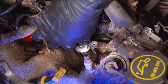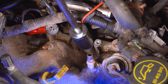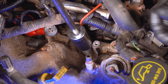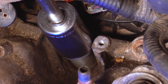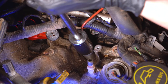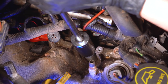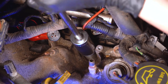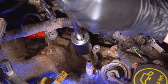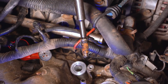Now thread this nut down until it bottoms out by hand — this will seat up against the sleeve. Get the appropriate size socket for this nut. You're going to reverse the nut, which will pull the rod up. I'm going to be quiet so you can hear the noises in there — most likely you'll hear it break free and start pulling up. That first pop was the metal breaking free, so that's a good noise. Now I'm just turning it and it feels very smooth — it's getting easier to turn, which means that sleeve is pulling out. Once you've threaded this in enough and the rod has pulled the sleeve up enough, remove your tool and pull this up. This is exactly what you want to see.